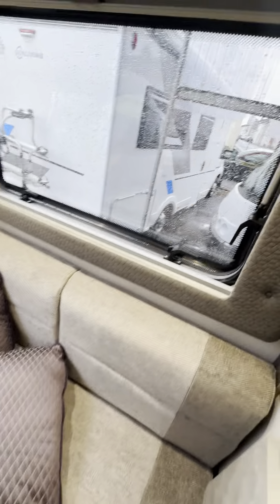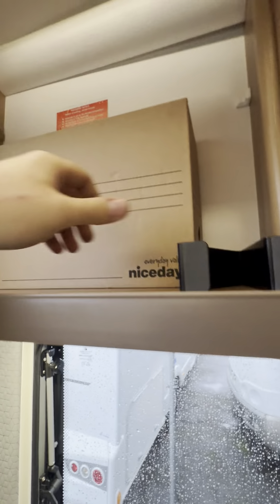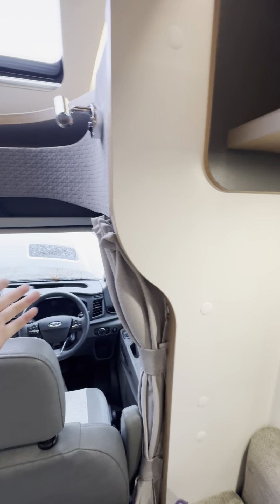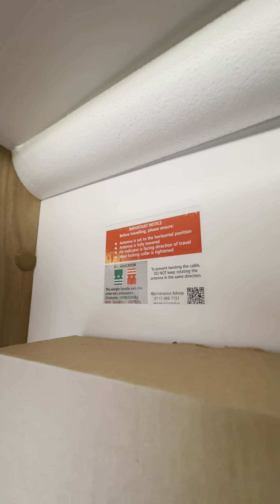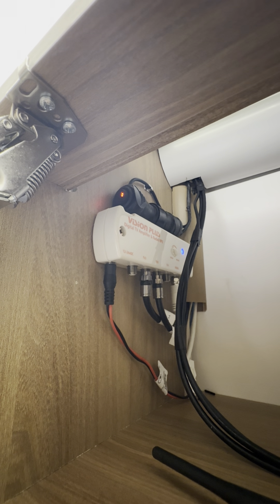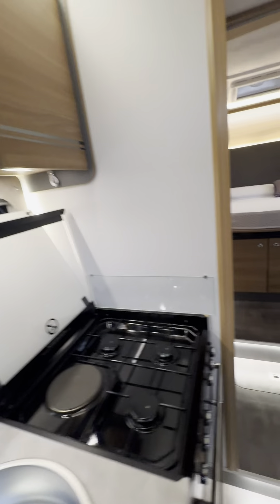Before the control panel, let me show you this front cupboard. This brown box is where all your paperwork will be — don't expect stacks of it since the van is nearly brand new at only two years old. In this locker you've got your tilt-and-turn TV aerial up there with a little diagram showing how to use it. On a campsite, try to copy where everyone else is pointing their aerial. You've also got your TV aerial booster — make sure that's switched on to get signal through to the aerial sockets in the van.